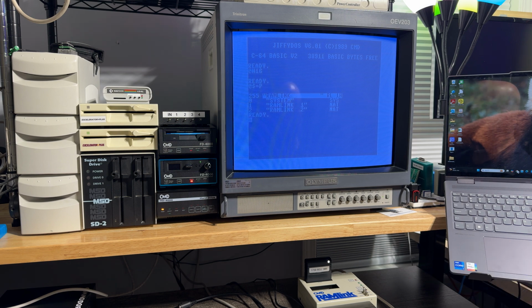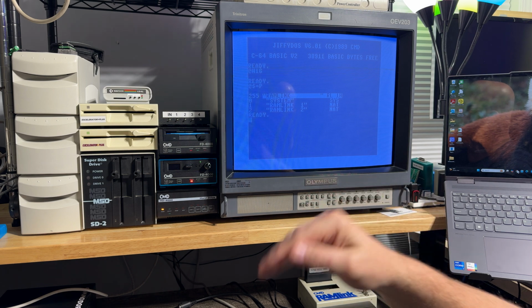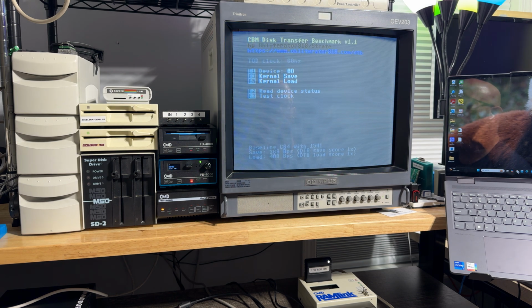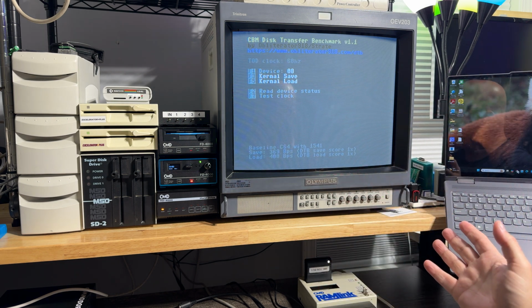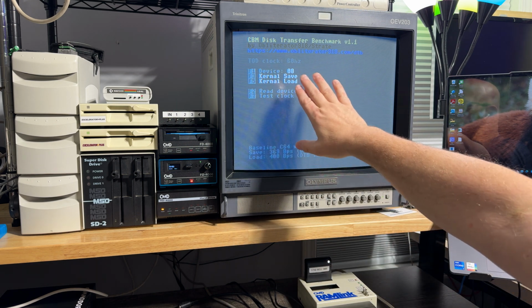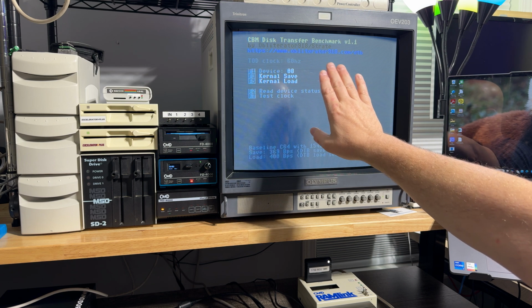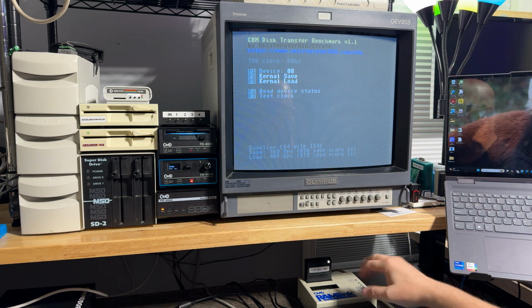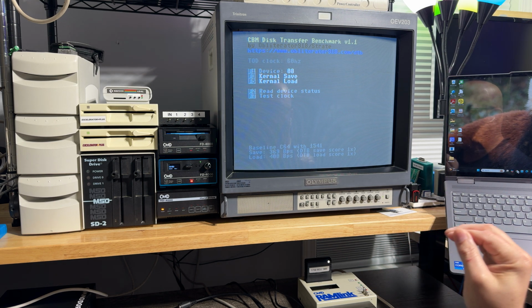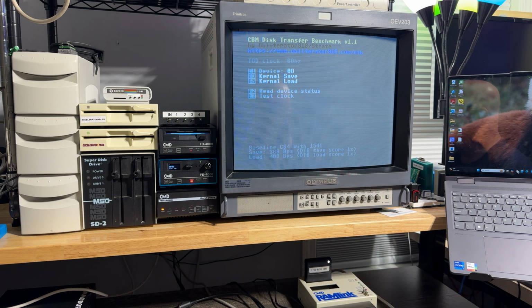We're going to start with the same test that we did in part one, so you can remember what the speed was with that. I've got my program over on drive 11 that we've been using for our benchmarking. If you haven't seen my other benchmarking episodes, go look at part one and part two, but part one actually had this test in it. If you remember, we can only test drives 8 through 11, so I'm going to hit the swap 8 button here on the RAM link. Now the RAM link is sitting at drive 8, and we're in the first partition, which means we are actually on the 1750 REU clone.